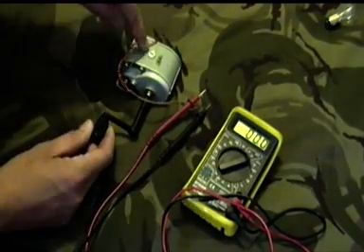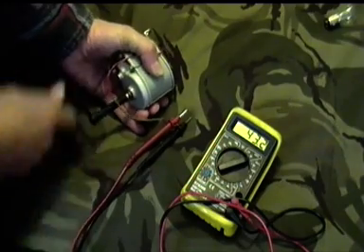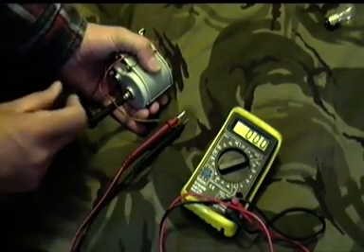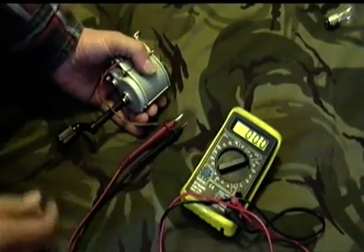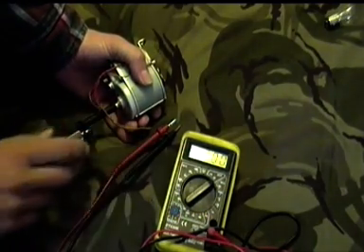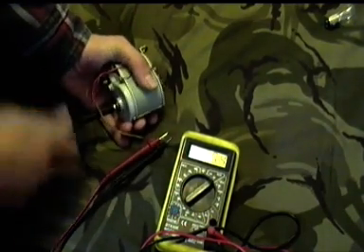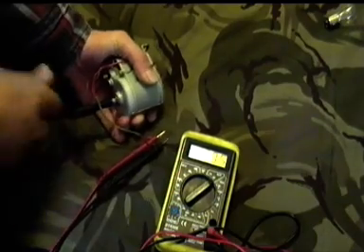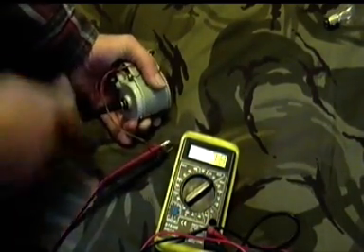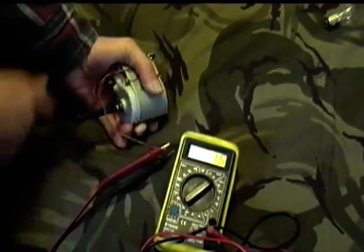If you wind it backwards, quite often the handle unwinds on these - they're made so that they just screw on. You can see here: voltmeter, AC volts. If I give that a little flick, it jumped up to 44 volts. And if I give it a nice constant run: 65, 68... speed it up a little bit - into the 70s, a little bit faster, into the 80s, 87. Just went over 100 volts, into the 90s.